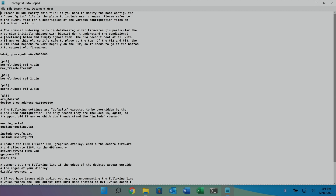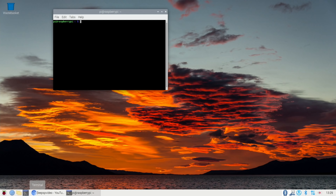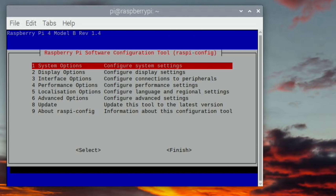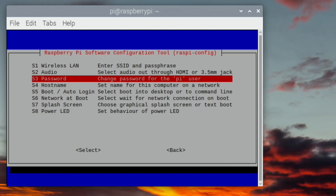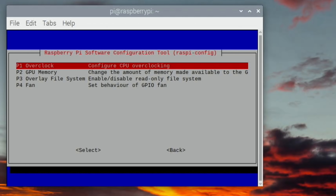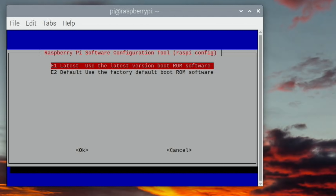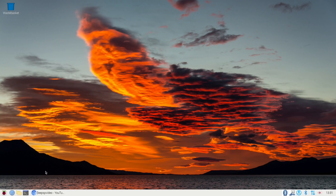Back in Raspberry Pi OS 32-bit, I want to show raspi-config, which handles lots of settings similarly to config.txt. Run 'sudo raspi-config' in the terminal. You get options like system options for changing audio between HDMI and the 3.5mm jack, changing password, display options, performance options — note the overclock option doesn't work on Pi 4 — and advanced options including updating the bootloader. If your Pi 4 has an older bootloader it won't support USB boot, so update it within raspi-config.